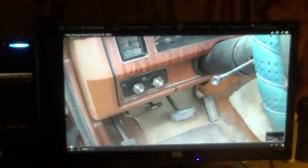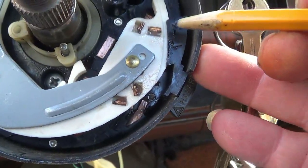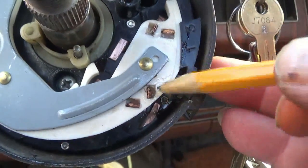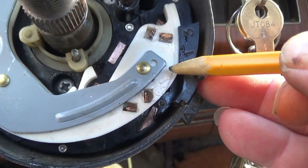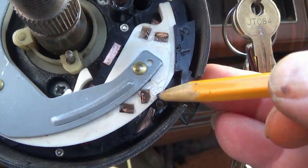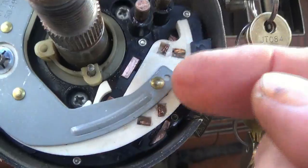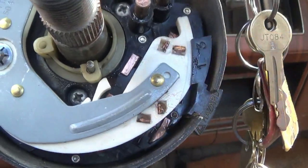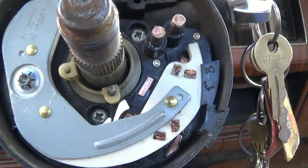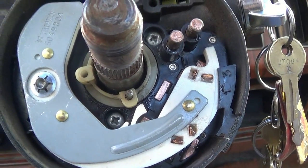First thing I'm gonna do is disconnect the battery. Okay, it was this arm here on the inside. I done got it pinned down, can't show you. But it was hanging up in the plastic just a little bit, and we wouldn't get no blinker service. So I took it out and bent it just a little bit where them little springs make it go back and forth very easily like the other side was doing. Yeah. Now we have blinkers. It was pushing down and kind of sticking. So you got to make sure both of them push down and come up really easily. Yeah. Like they're supposed to.